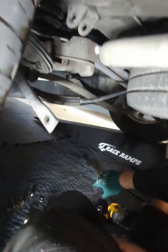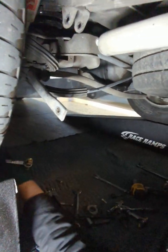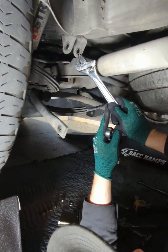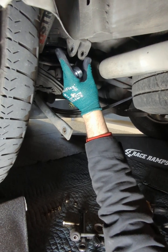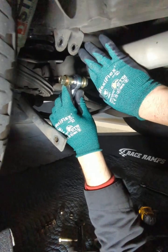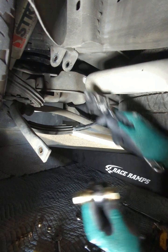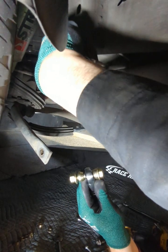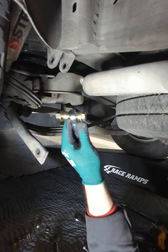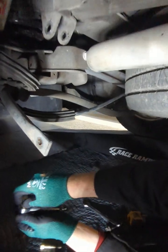Pretty basic. On certain models GM runs, so you guys know, from a 2020, the rear control arms back, they're all the same. These mounts on both sides, GM, some of them are thinner, the actual spacing between, some are thicker. So what I did when I had a company machine all this for me is I had to do the midway point. So sometimes you might have to open it up. Let me get a little crescent. I don't know if this one's going to have to be like that, but you just open up a little bit here. And it's only 1 to 2mm of space. A lot of these aftermarket companies, when they do these mounts, you gotta bend the hell out of them, not these. So let's see how this one works out.